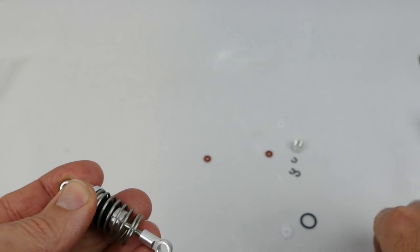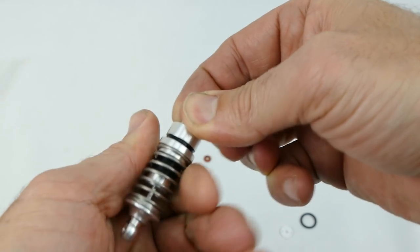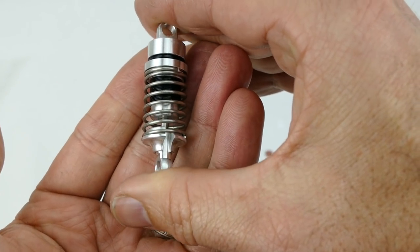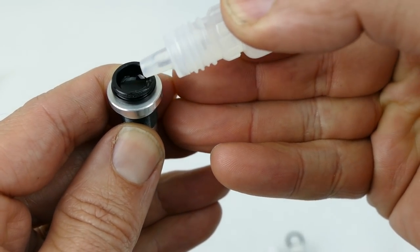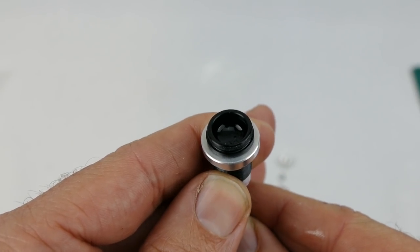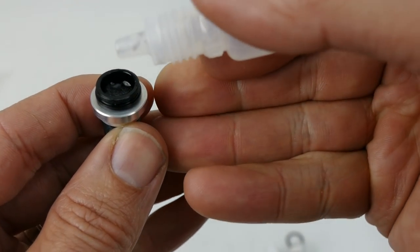Like any other normal shock, you just install the spring. There is one shock done — they look cool. I love that steel colour with the polished aluminum together. I have four to do, and when I get to the stage where it deviates a little bit I'll start the camera back up. There is a shock oil provided — I think there's just enough for all four. Go carefully, don't overfill it, and make sure you get rid of as many air bubbles as you can. Go slow and keep filling it up near the top — don't go all the way.